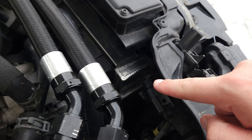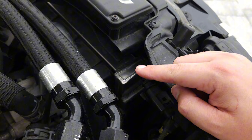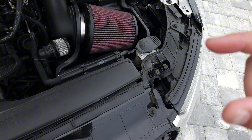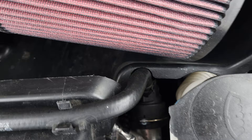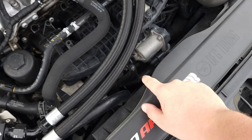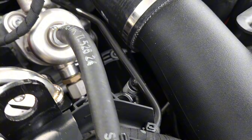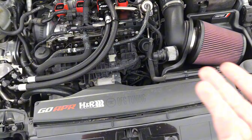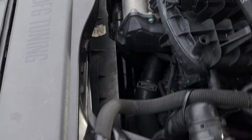Going down to one of the harder installs — there's a big radiator and a CTS intercooler down here. The radiator was around $300 and the CTS intercooler was around $600 on sale from $800. It added around 2 extra inches of thickness, so I had to dremel some things down because it got really close to the coolant pipe, and I had to trim down my fan. It also started cracking my manifold sensor, which you can see is cracked, so I had to trim that down too. I also have intercooler piping — I think it was DFG for about $90 — and the EQT charge pipe from the turbo to the intercooler, which was around $200 but is now selling for $80 online.